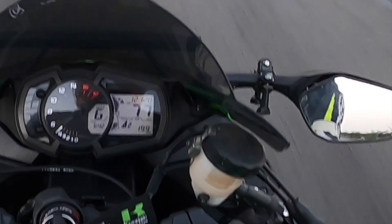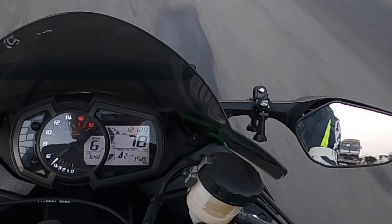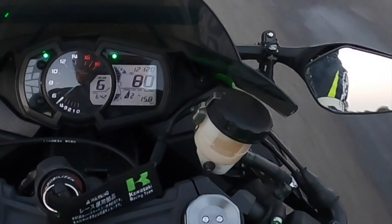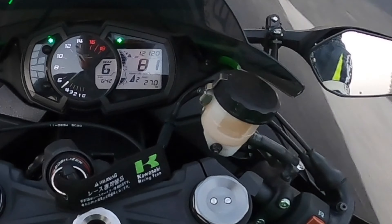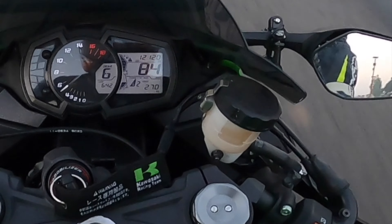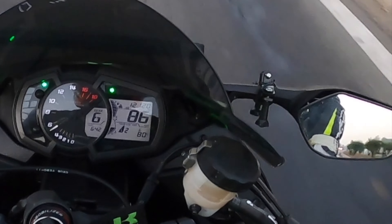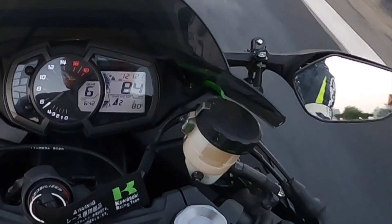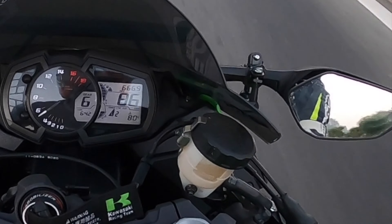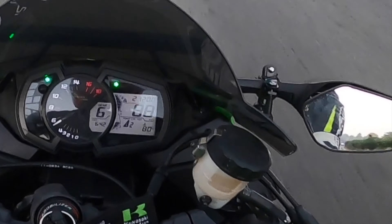For people checking on my mileage — that is a mileage of six hours riding, and average fuel economy of around 19 kilometres per litre. You also have an option to see distance to empty or range, which is not totally accurate but works well. And up top you can see the total kilometres clocked, plus trip A — I reset this every 3,000 km when I usually change oil — and trip B if you want to track something else.